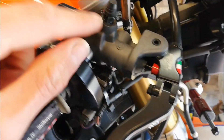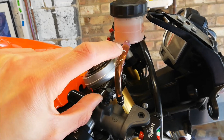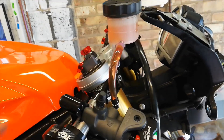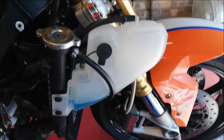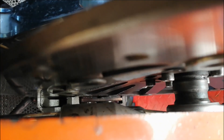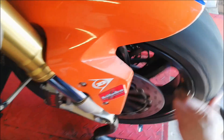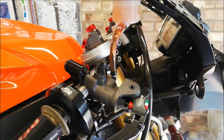I ended up having to bleed out the top port first with a little piece of pipe so I could actually see any air bubbles coming out of it. It did take a while to bleed up and get the air pushing through the calipers, but now that it's done there is no pad pushback at all — or none more than you would expect. That's an excellent job — it's just nice to know that they're now a hundred percent.